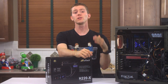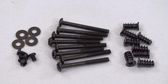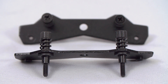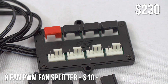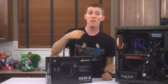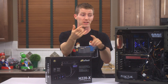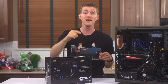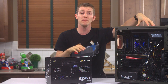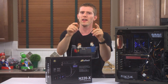In terms of accessories, Swift Tech includes thermal compound and all the mounting hardware you need for LGA 1155, 1150, 1156, and all that good stuff, plus extra hardware for Intel LGA 2011 and AMD sockets. Finally, and this is a really great inclusion, an 8-port PWM fan splitter that uses SATA for power and the CPU header on the motherboard to control speed. The pump is also PWM compliant, so your whole system's performance and noise levels can be adjusted dynamically according to CPU temps, depending on how you set up the fan profile on your motherboard. Very, very cool and very intuitive.